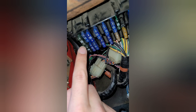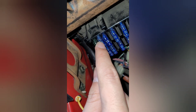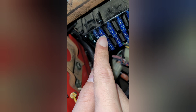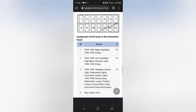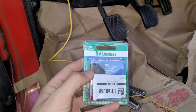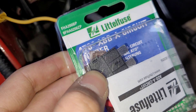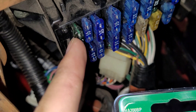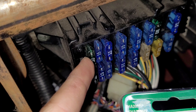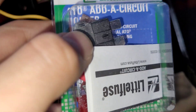I tested all of the fuses to identify which is which. Fuse number one controls the right headlight and fuse number two controls the left headlight. Here's a useful fuse box diagram — please pause to review all the fuses. I'm going to tap into fuse number nine for the tachometer lighting, because fuse nine only turns on when the ignition is on.